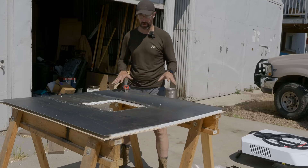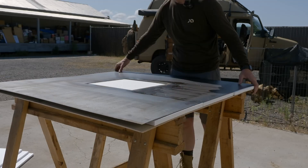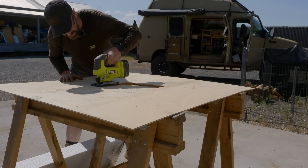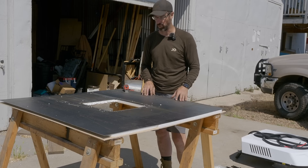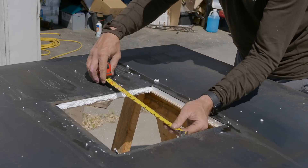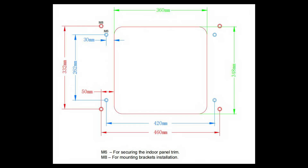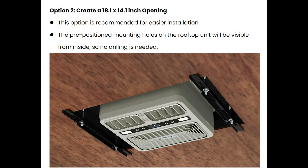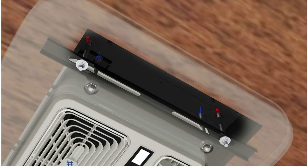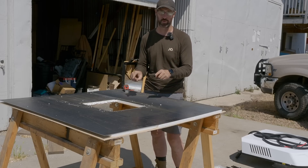I've created this mock-up roof using a piece of 16-gauge steel, some foam insulation, and a quarter-inch piece of plywood, similar to most RV-style builds where your interior is going to be some kind of thin plyboard. I've created a 14-by-14-inch hole, which is one of the ways you can install this air conditioner — using an existing 14-by-14-inch hole if you're putting it where an old fan used to be. They also have an option with a 14-by-18-inch hole, but since most of you are probably retrofitting an older setup, I'm going to show the 14-by-14-inch method today.